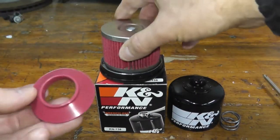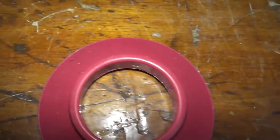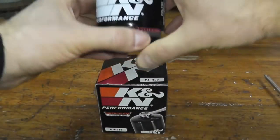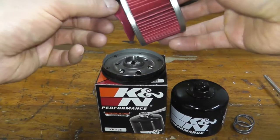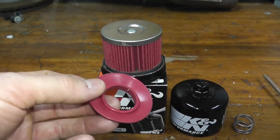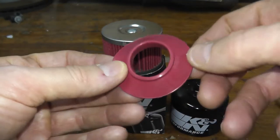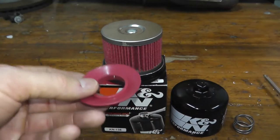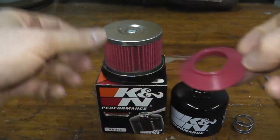This component is your anti-drain back valve. When you shut off the engine, instead of all the motor oil draining back into the crankcase, this valve keeps the oil inside the filter — so the next time you start your bike you won't have a dry start. You typically find either a silicone or a nitrile rubber anti-drain back valve. This one happens to be silicone, which is what you find on higher-end filters. Silicone can withstand lower and higher temperatures far better than nitrile rubber. This is an $8 filter on Amazon, and higher-end filters consistently use a silicone anti-drain back valve.